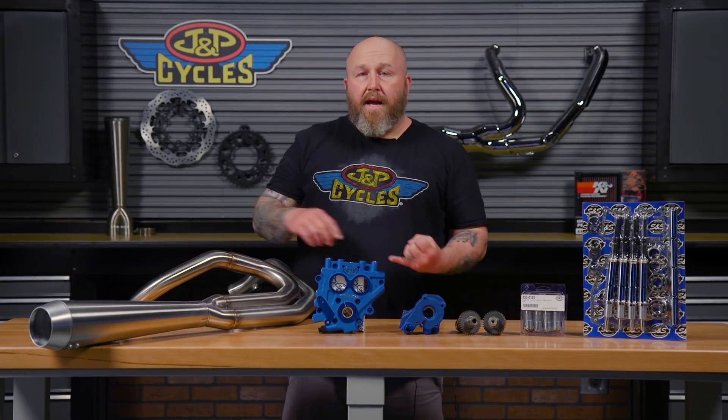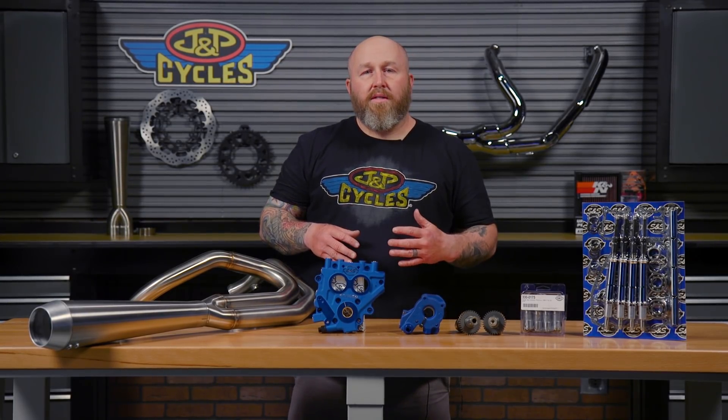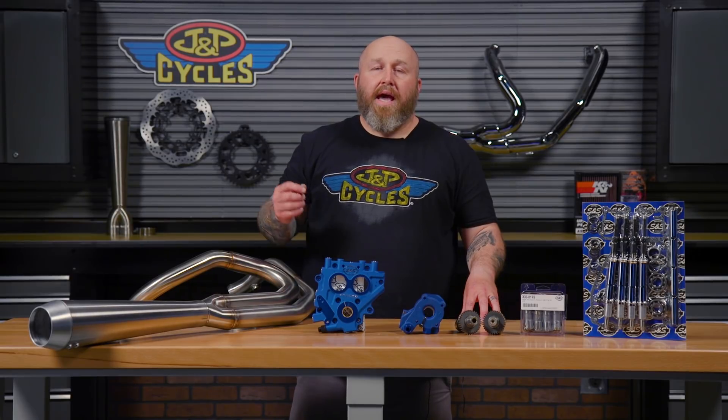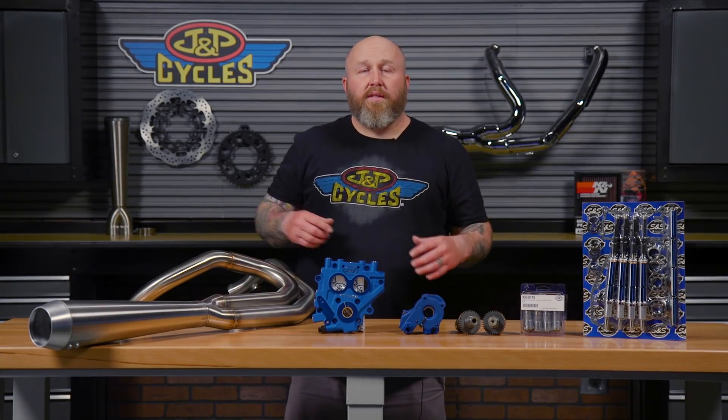After your Stage 2 build, you're going to have intake, exhaust, a good cam selection, and that fuel injection control — you're going to have a pretty hot running motor. When you choose your fuel injection controller, especially for Stage 2, you're going to want something that has a wide array of maps available from the manufacturer, or the ability to have a map written to it, or the ability to have wide band O2 sensors added and a closed loop system run on it. That's going to give you the flexibility to tune the fuel range you're going to need for the cams, the headers, and the intake to really make some power.